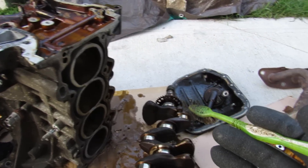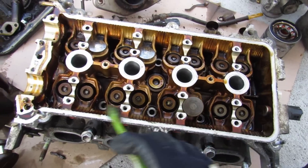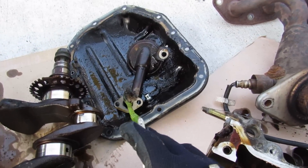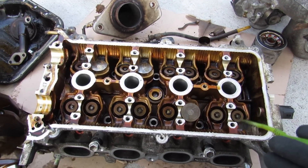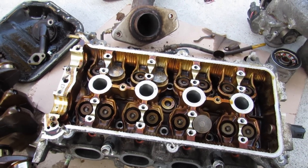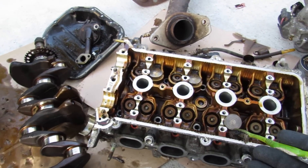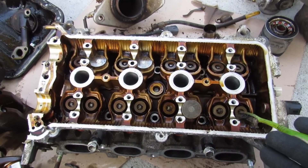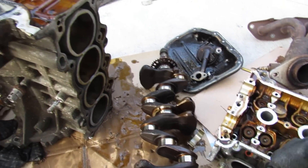Overall the main theme of this engine's condition is oil — tarnishing throughout and sludge at the bottom. This makes it critically important to keep up on oil changes and use good quality oil if you want your engine to last. There isn't much mechanical wear for an engine with 500,000 kilometers, but that's partly because this is a hybrid vehicle where the internal combustion engine isn't running all the time, so you can't expect as much wear.